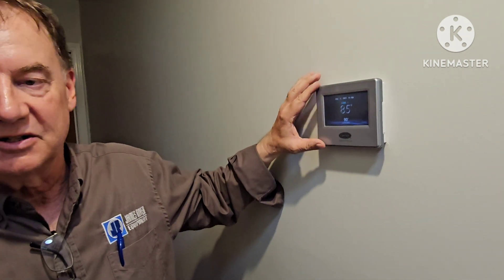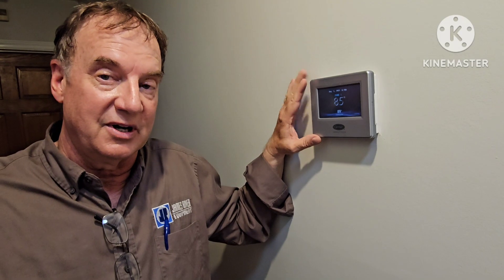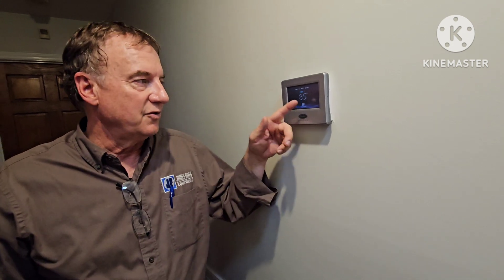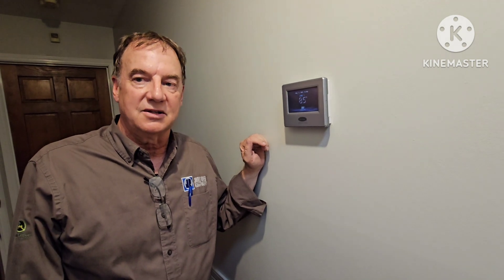Hi, I'm Ken Jake and I just wanted to show you how to fix this. We have a Carrier air conditioning system heat pump with an Infinity indoor unit. Saturday afternoon I noticed it was getting kind of warm in here and it had quit, and it threw on the Infinity screen a code 44. So at least it tells you kind of what's going on — it showed that the electric motor running the air handler unit was throwing a problem.